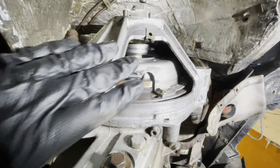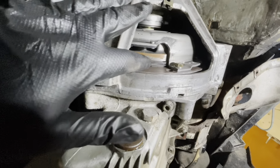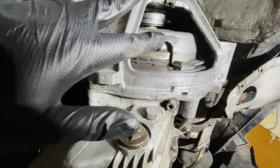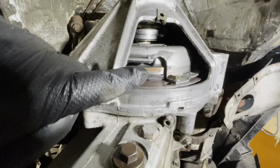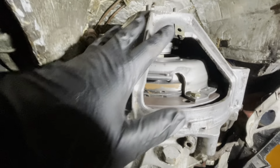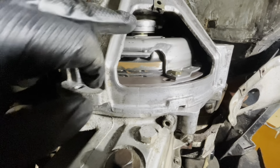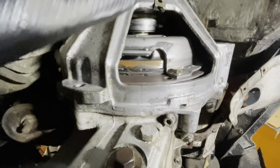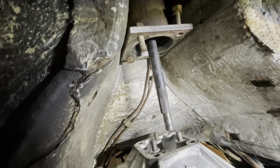Alright, so I've now got the pressure plate just loosely tightened. I think the clutch is centered. I'm a little worried. I think that tool I bought is a bit dodgy. But what I've done now, I've just moved the bell housing to the spot where it belongs. I will just bring 1 or 2 bolts and just lightly tighten it, because before I do the final assembly on this, I want to make sure that this drive shaft actually slides in.